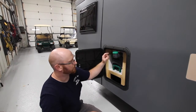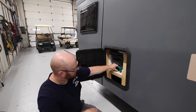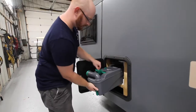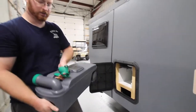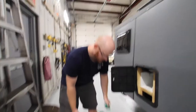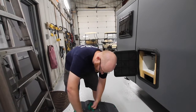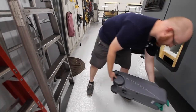This tube here comes out and you can fill up fresh water for the toilet through here. To remove your black tank, there's a green tab — pull up and pull out. On top you'll find the fill cap. You take this to your dumping station. It has a little handle. Once you get to your dumping station, you can pull this open, remove the cap, lift up, and dump it out.